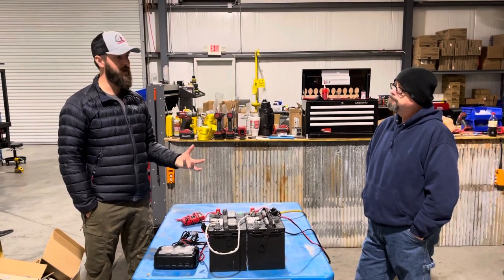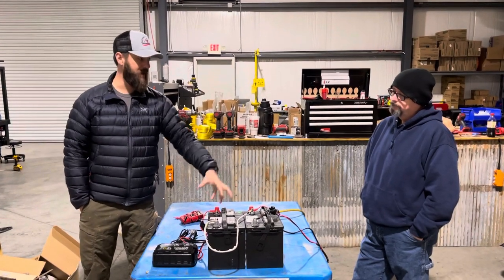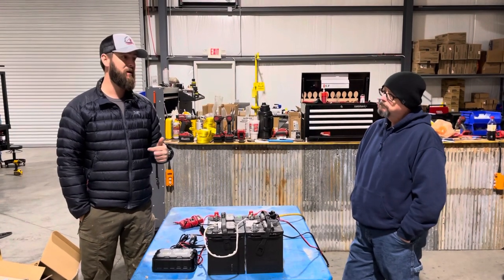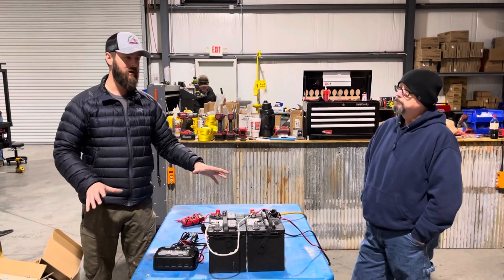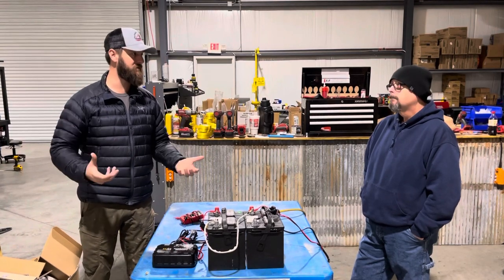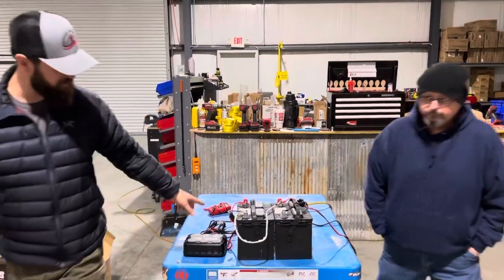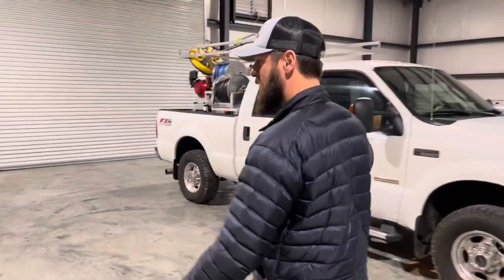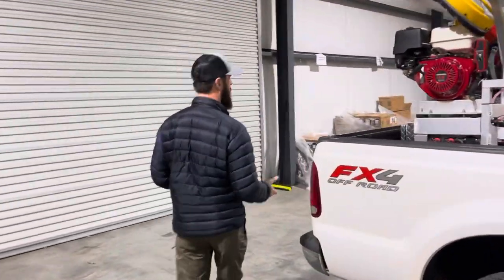The only drawback for our purposes is we don't have a huge bank on the 24-volt side and it's pulling a lot of juice. So what we're experimenting with — we've got some coming — are lithium battery packs, to keep the simplicity and cleanliness of the wiring but get a lot more available run time. Actually, we can go look at the truck — let's take a look over here. This is our work truck, and it's got a 12 and a 24, so we'll let you guys see what it looks like inside the box.